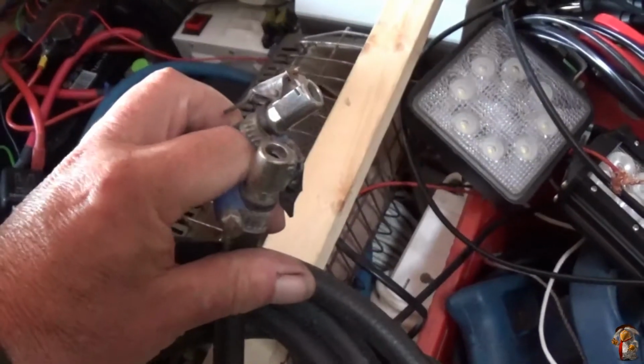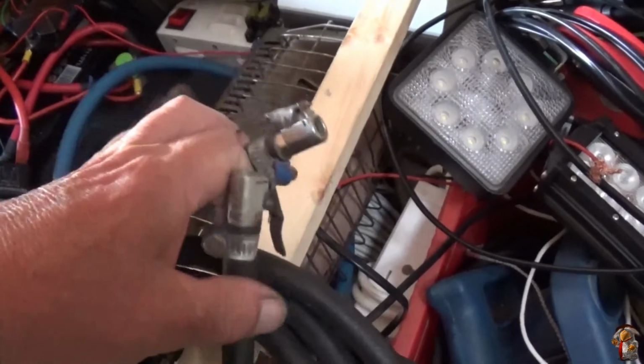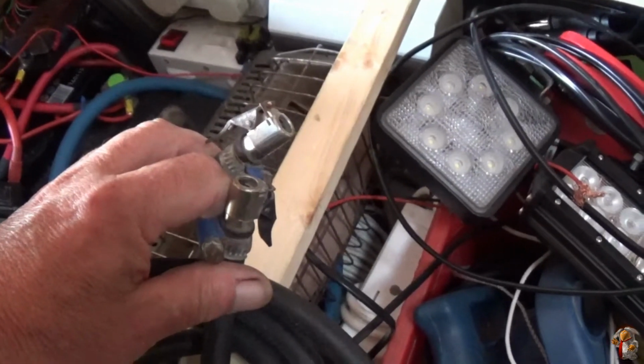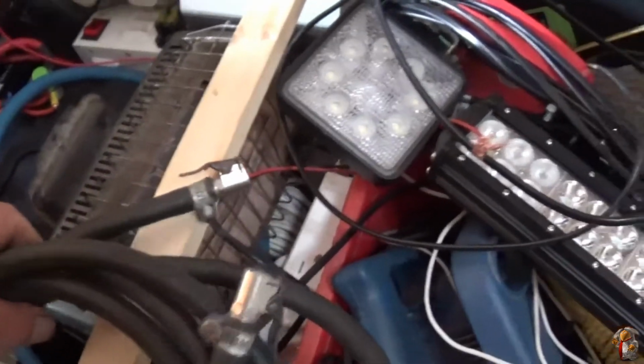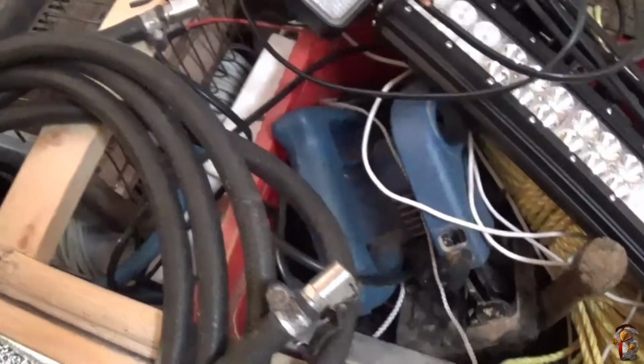That is, I think, a must when you have a transit. It's, if I can hold the lid up whilst it's an airline. It's got a connector both ends. So if you've got a slow puncture, you can use the air out of the other tyre, the other side, or out of the spare one underneath if you can't get him out, and balance the air in the tyres. I usually blow my back ones up, put that between the two, and they balance. So they've got exactly the same pressure both sides, and on the rear, on the front I mean.